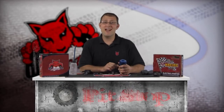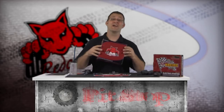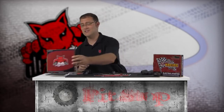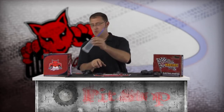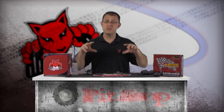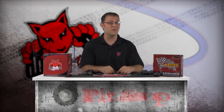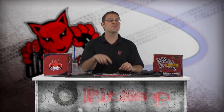Check operation of the Red Cat e-start electric starter system by first loosening the glow plug. If you don't have a T-wrench, you can get the optional Red Cat Racing Nitro Starter Kit, which includes tools you'll most definitely use on an ongoing basis — like T-wrenches, screwdrivers, fuel bottle, rechargeable glow igniter, and glow igniter charger. Go to www.redcatracing.com for more details. Removing the glow plug reduces compression and puts less strain on the starter just in case something was not aligned properly. Make sure the engine is spinning freely with no binding. If all is good, re-tighten the glow plug and install the engine back into the vehicle.